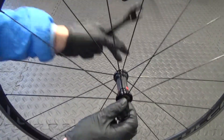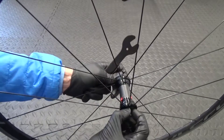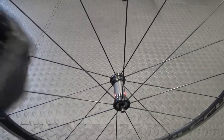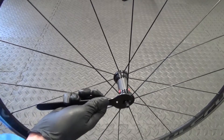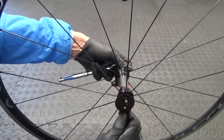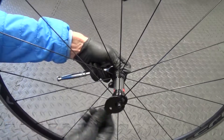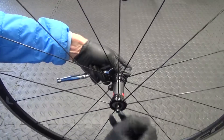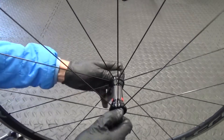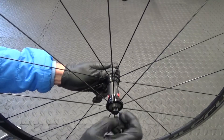You can see the flat in there - the piece where you had your spanner on the end. Just undo that. If you can't undo it by hand, hold this side and try. If not, get your spanner on there and hold the other side with your ratchet. Just crack it undone to get it moving, then you should be able to wind it off because it goes through into the middle of the bearing.